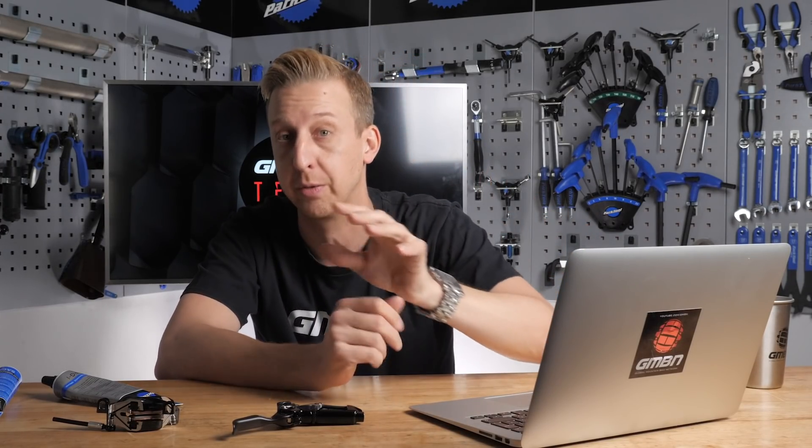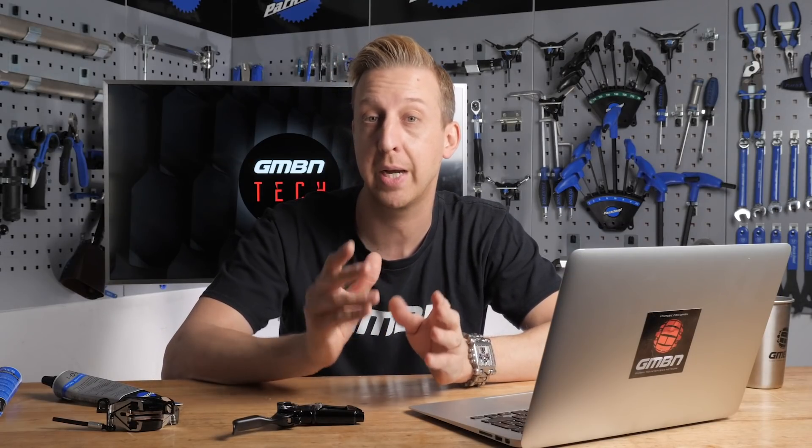Other carbon wheels can be so stiff they actually feel harsh. Some pro and high-end riders really like this because it feels very direct - you can feel exactly what the bike's doing, the tracking, the frame flexing. But it can also be incredibly uncomfortable. I've got friends who've upgraded from alloy to carbon wheels and gone for high-end brands like Envy - they're insanely stiff and might not be what you're looking for. So just swapping from alloy to carbon isn't necessarily a solution. Going from a heavier wheel to a lighter wheel is the way to do it, and you can get that with alloy as well as carbon.